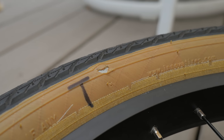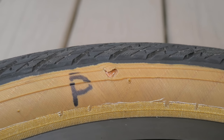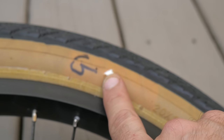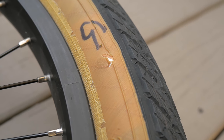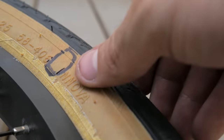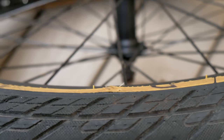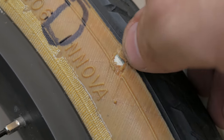Alright, it looks like the tape is stressed pretty bad, but still not bulging terribly. In terms of deformation, the patch is doing bad — you can clearly see the bulge in the tire, and it's only a matter of time before it leads to something worse. Now, this was the big glueless patch hole which we replaced with a tire boot, and although the hole easily flaps open, there's barely any deformation in the tire. The smaller hole looks about the same — it's obviously stressed around the tear, but it's not bulging. Then we have our one dollar bill, which is performing every bit as good as the tire boot. This hack keeps surprising me because it's just sitting there bracing the hole. Wow — a hack that actually works.